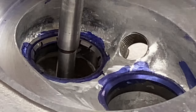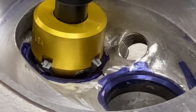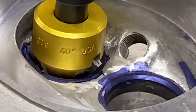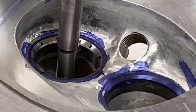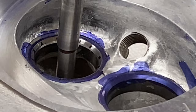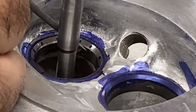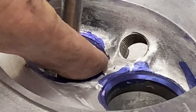We'll do the 60 degree next. Now you can see the cut here — see the little black line? That's where the valve will seat on that area, and then it's got a 60 degree cut down there. The transition is much smoother that way.